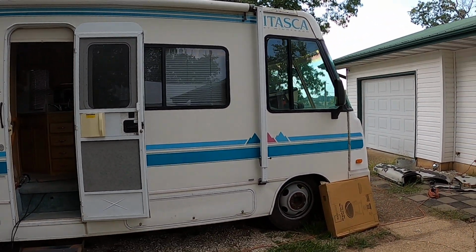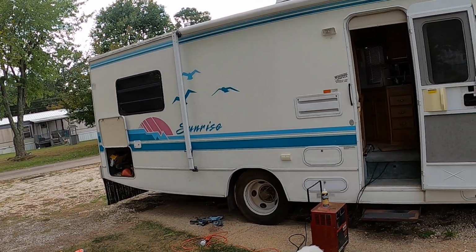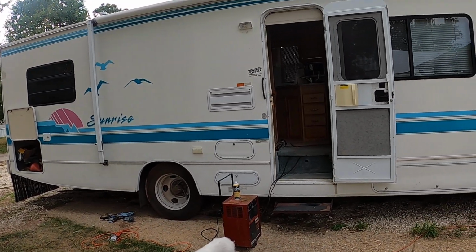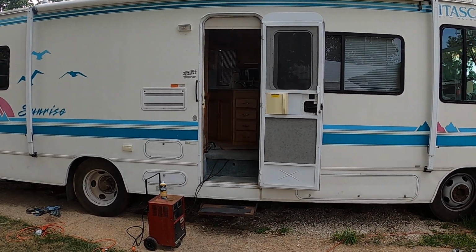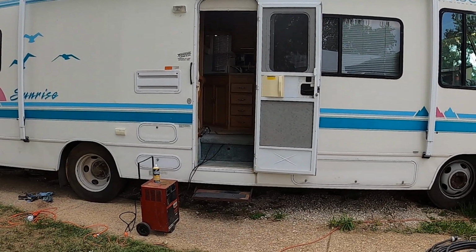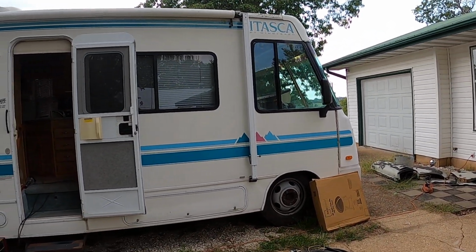I tell you what, guys, I bought this thing for $100. And I know you probably don't think I'm telling you the truth, but I did. I bought it for $100. And it's got a 454 in it. It's got 42,000 miles on it, I think. And after I did some work to it initially, I initially had to replace the ECM because it was blown, and I had to replace the fuel pump and do a tune-up on it. And then I drove it for about 20 or 30 miles to a storage facility, and it started running really crappy. And I ended up finding out that I had like 3 or 4 bent push rods because the valves were sticking.